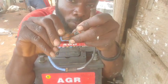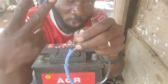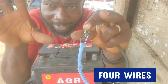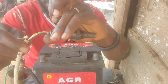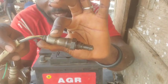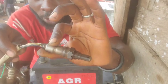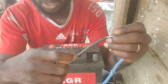On the four-wire sensor, after the two black heater circuit wires, you're left with a white wire and possibly another colored wire — those two remaining wires are the signal wires. The five-wire O2 sensor is a completely different ball game. On a five-wire sensor, none of the wires are the same color, but I'll show you which two are the heater circuit so you can identify them and avoid short-circuiting things.